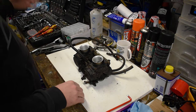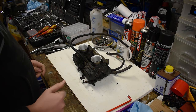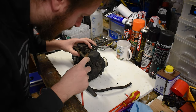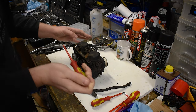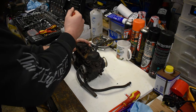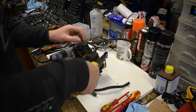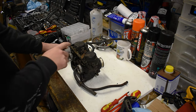For now all we're going to do is break these down and get them into the ultrasonic bath at some stage. The plan is to get all this apart and broken down so it can be cleaned. I have a feeling I'm going to be replacing a lot of screws on this - I think rust is going to be the biggest challenge with this bike. There's rust everywhere and I really don't want to have to drill out too much. That one is going to have to be drilled out - it's actually just cheese. So I'll cut a channel into the rusted ones with the Dremel and see if I can then turn them out.